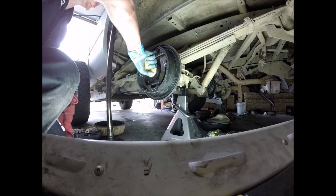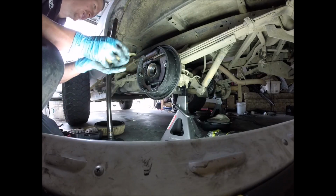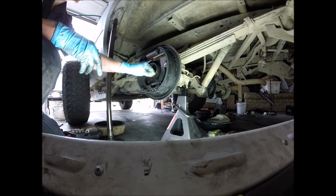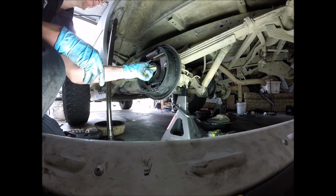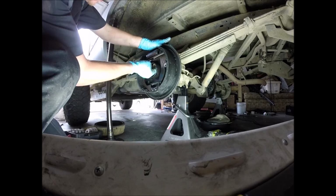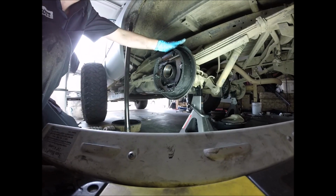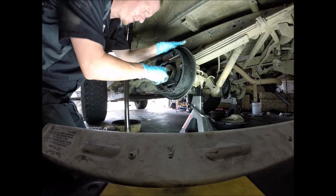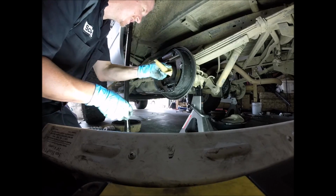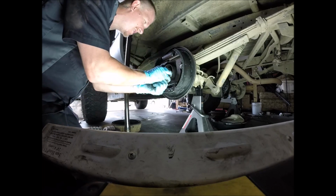Just get the stuff that's inside there. Just sand it down a little bit. You're not gonna do this a lot, because then if you oblong it or make it an untrue circle, you're gonna run into way more problems. Don't just do where the bearing meets, also do where the seal is gonna meet, just so you don't have any open air areas on the seal.